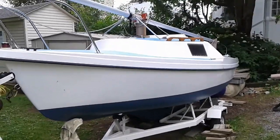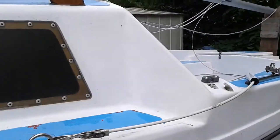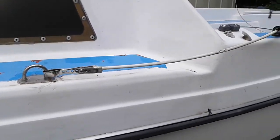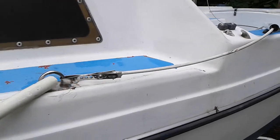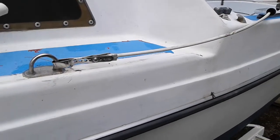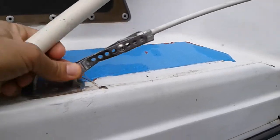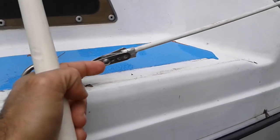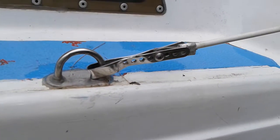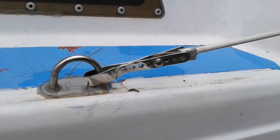Hello, in today's video I'm going to show you how to install a new turnbuckle protection pipe with an end plug. This is what would usually be a turnbuckle, but on this sailboat it has a device where you can unscrew the nut and machine screw and then adjust the tightener. On many sailboats it's just a turnbuckle that you can easily adjust without unscrewing anything.